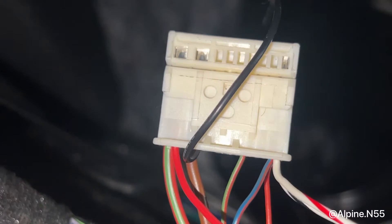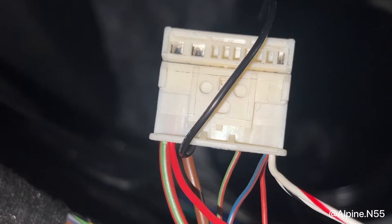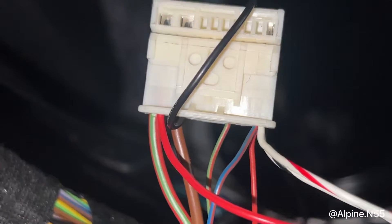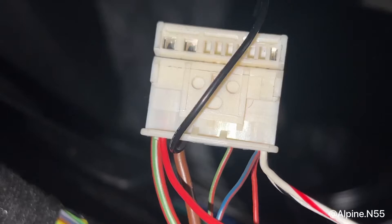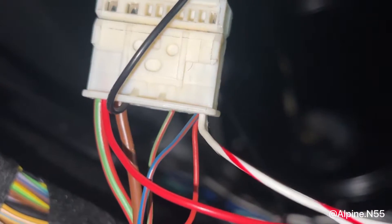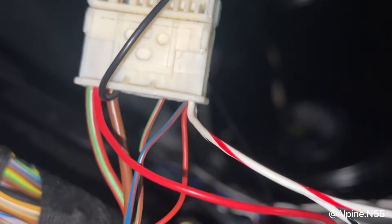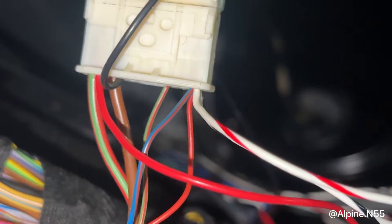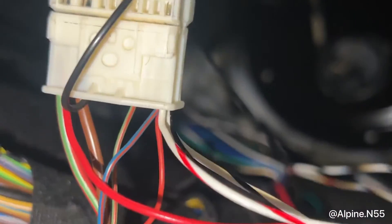Here's how the wiring is all done. Our red and green wire is going to be 12-volt to the EKP, which is going to hook up 12-volt to the Z-Tronics. Our brown wire is going to be our ground, and that's going to hook up to the black wire from the Z-Tronics. Our CAN high and low: the red and blue wire is going to be our CAN high, hooking up to the white and red wire from the Z-Tronics. And then our solid red wire is going to be CAN low, hooking up to our white and black wire.